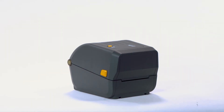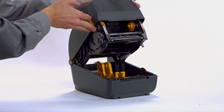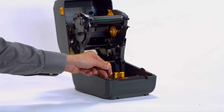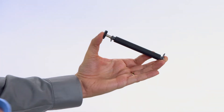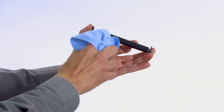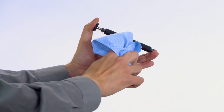Cleaning the platen roller. In this video, you will learn how to clean the platen roller. Use a Zebra preventive maintenance cleaning swab or a lint-free cloth or swab moistened in 99.7% isopropyl alcohol to clean the platen. Open the printer. Release the two bearing retainers and rotate them up. Isopropyl alcohol can thin adhesives and oils without completely removing the debris. Clean the platen roller while turning and moving from end to end.